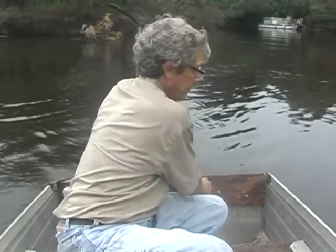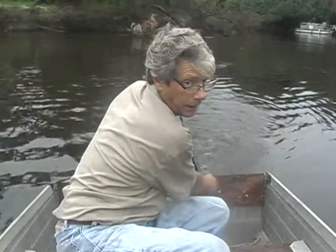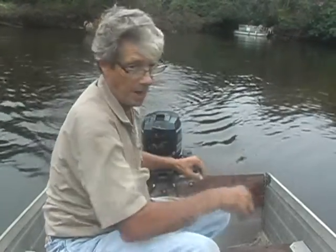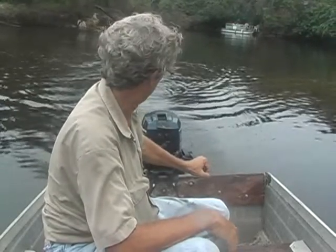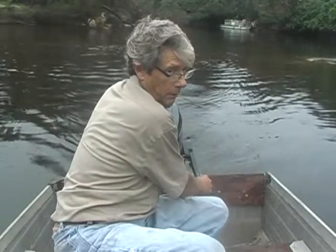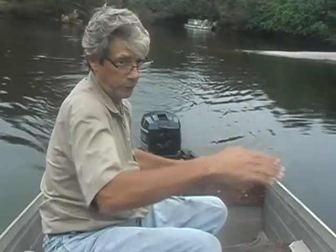That sound nice? Like I said, it's a lot quieter. It's a lot quieter when the exhaust is all the way down in the water. The reason it changes when I lift it up real quick, or set it back down real quick, is because the fuel in the bowl is sloshing around a little bit.